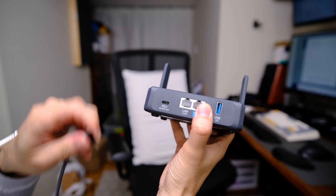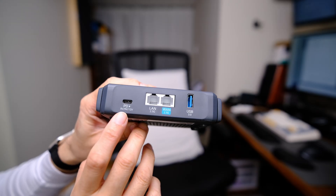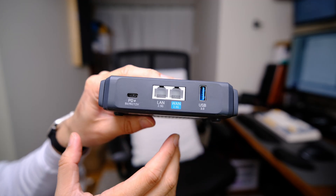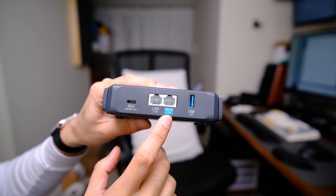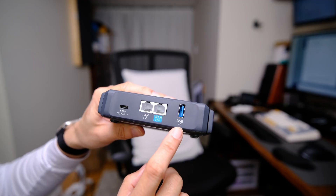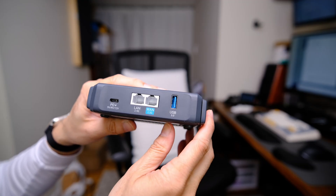Going to the back: we have our USB-C power delivery port, which supports 5 volts, 9 volts, and 12 volts. I put this to a meter and it's really only drawing 5 watts of power, so it's very low energy use. We have our LAN and WAN ports — these are 2.5 gig ports, and you can convert both to LAN ports if you're in repeater mode. And then we have our USB 3.0 port — you can hook up a hard drive or flash drive, though it needs to be in FAT32 or exFAT format.